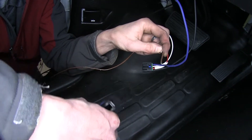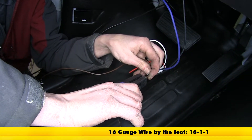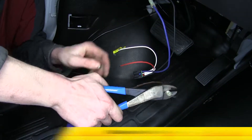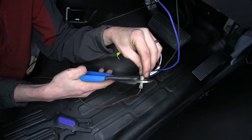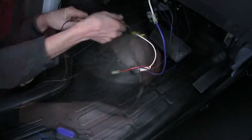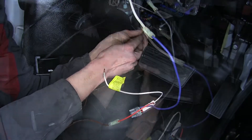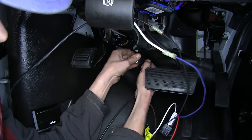We have a segment of brown wire — just 16-gauge wire — which you can buy on our website as part number 16-1-1, sold by the foot. You'll probably need about six feet in order to do this. With that secure, we'll just tape the other end of our wire with some electrical tape to our black wire right here. We want to wrap this fairly tight because we're pulling it through the firewall.